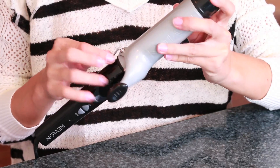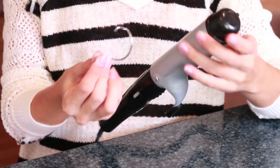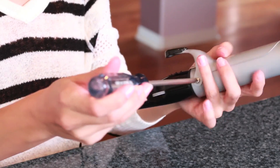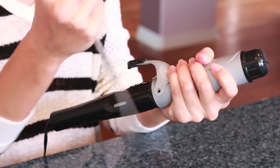So it's pretty easy. The very first step is just to take off this clip. Now depending on what kind of curling iron you have it's going to be a little bit different, but the basic construction of these inexpensive ones is all relatively similar. All I do is just kind of lift up on one of these little side pieces here — it slides out of the screw and then you can take it off on the other side as well. You just pop that one piece right off and then you can access the two screws that are holding the clip on. Take your Phillips head screwdriver and carefully — while holding the clip, because there is going to be a spring behind it and you don't want it to shoot the whole thing off — grab onto that, hold the clip, and insert your Phillips head into one of the screws and unscrew it.